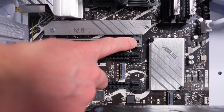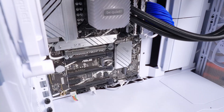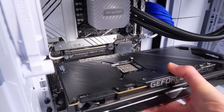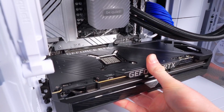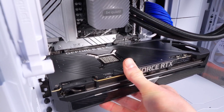The easiest way to find the right slots is to pick up the GPU and line it up with the PCIe slot on the motherboard. When you do that, it's easy to see which expansion slots the GPU's backplate will need access to. On this case the expansion slots are secured with screws, so I'll unscrew those and slide the mesh covers out of the slots.